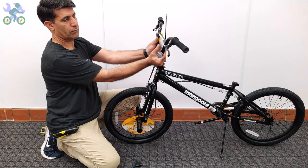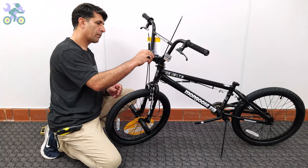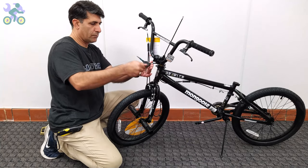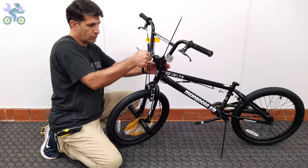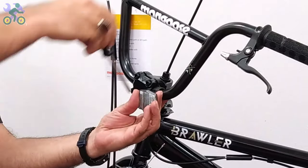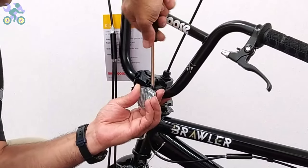Adjust the distance between the handlebar and the rider and tighten the screws crosswise. If the reflector is loose, align it horizontally and tighten it with the Phillips screwdriver. However, be careful not to over-tighten the screw because it may cause the reflector to break.